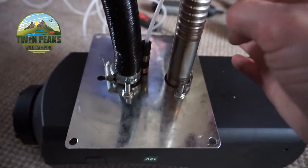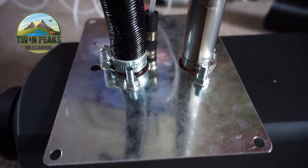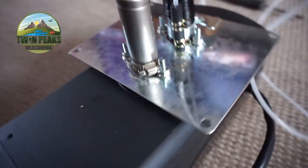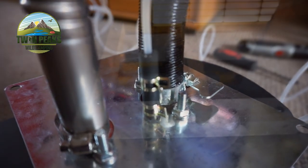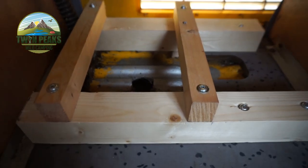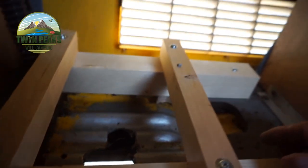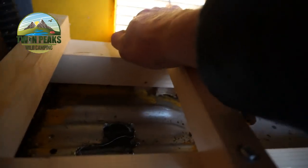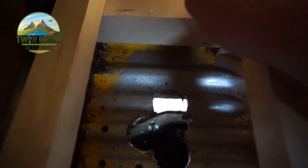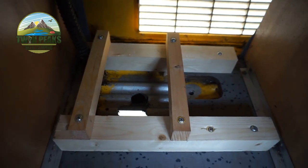The exhaust pipe is attached with a jubilee clip, as is the air intake. And if I spin that around, you can see the fuel pump is attached as well. We've had a change of plan - I've had to raise it up off the floor a bit, because when I drop the two pipes down there, there's not gonna be enough room for both of them. So what I'm gonna do, I'm gonna drop the exhaust underneath the van, and the air intake I'm gonna have to take it straight to the vent, because under the van there's just not enough room for both pipes. So that's the plan anyway - let's see how that works out.